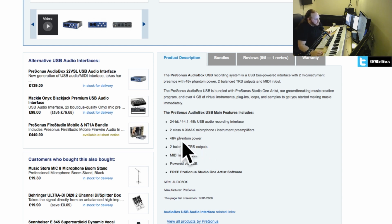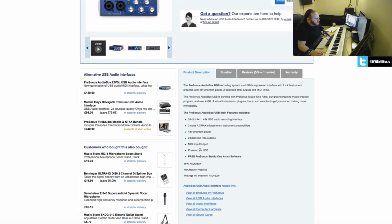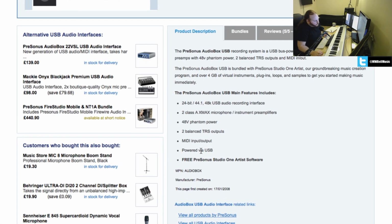48 volts phantom power. That's basically relating to condenser microphones, which require power. I will talk about that in one of the next videos where we're starting to talk about microphones. This one works via USB. It says powered. So that means that essentially you don't need to plug this into the wall. It will take the power from the computer.